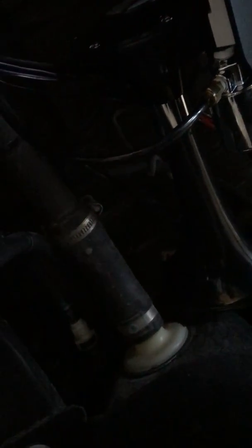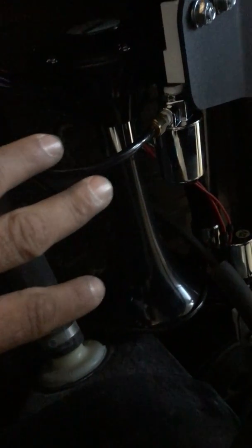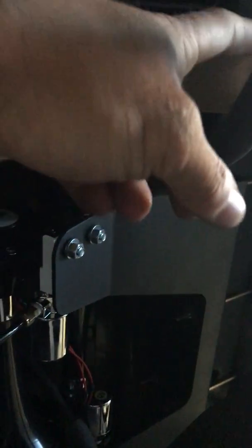You got your two red wires that are connected — that's going to turn into your purple wire, which is what's going to go to your actual activation switch. So whenever you hit that switch, that will be turning on. Just so everybody understands, this horn setup is completely different from the actual onboard air system compressor setup. So once you get that hooked up and it's tight, leave the horns off because the directions didn't make sense to me either. But when you put it all together it makes a little more sense. Either way, you're going to have this wire — this thing right here which is going to your brake — in your way to tighten it, but just finagle with it and you'll be fine.